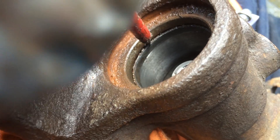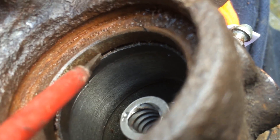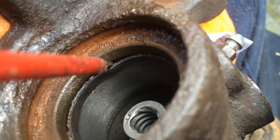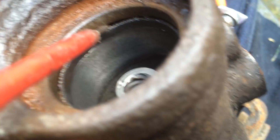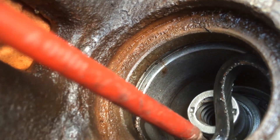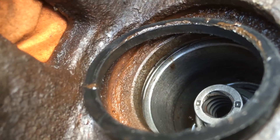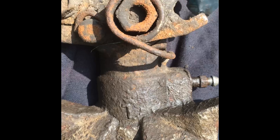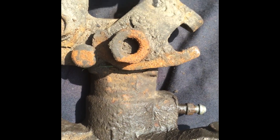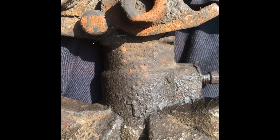I'm using the screwdriver on the square inner seal — this is the one that seals the piston into the cylinder and does the main work. I'm taking the return spring off the handbrake lever. If you pull on that you can see the inner adjuster moves in and out — you want to do that to make sure it's working properly and not seized.